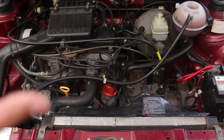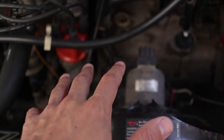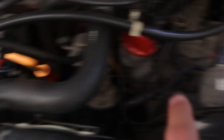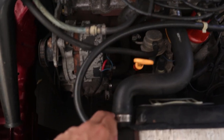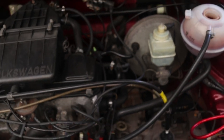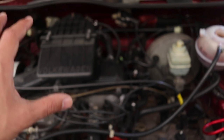I'm going to start off with removing all the wiring and electronics — disconnect the battery, wiring connected to the loom like the fan, distributor, reverse light switch. Then I'll tackle the water piping: the one from the radiator, the one at the bottom, and the ones running from the bottle into the heater and into the car. Once that's done, I'll take out the radiator which will give me more space, and then take it from there.